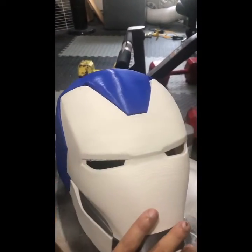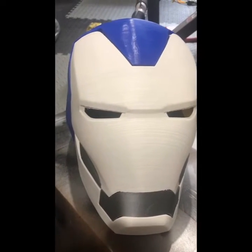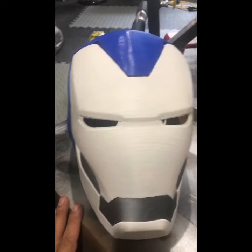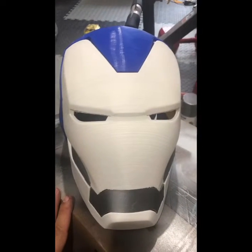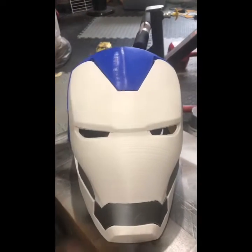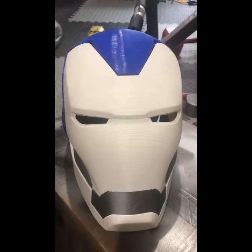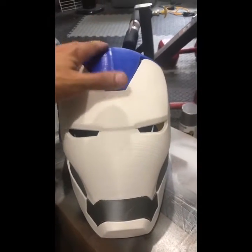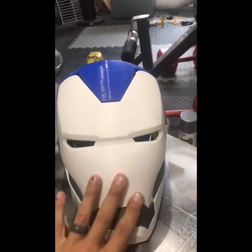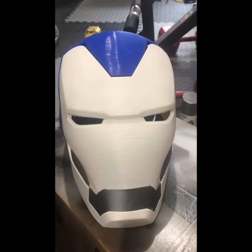So I may do some time lapses in this video. I know I kind of just talk and then show the before and after. So maybe with this I'll show some more in-depth process. But we're just going to use some Bondo brand body filler like we always use. I've shown it in a few of my videos. But I'm basically just going to spread that, let it harden, sand it down with 100 grit sandpaper, and then start working on everything else. So progress on to the next scene.